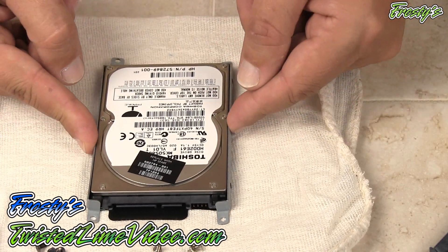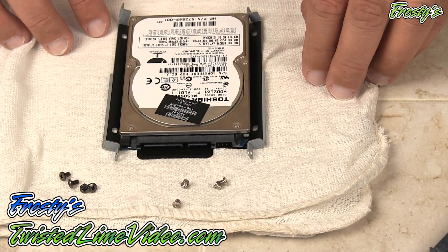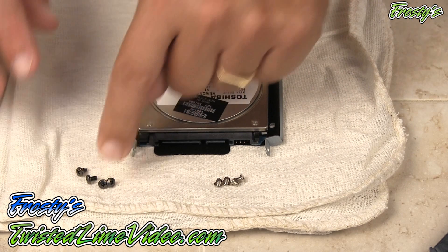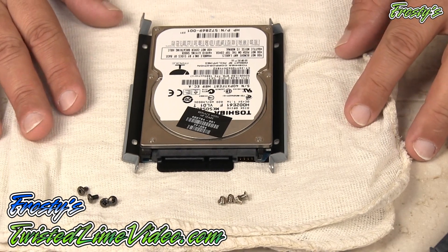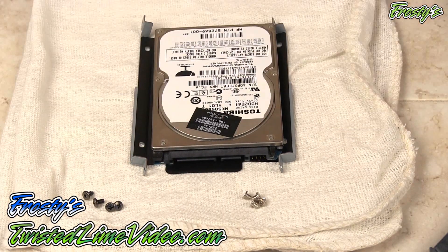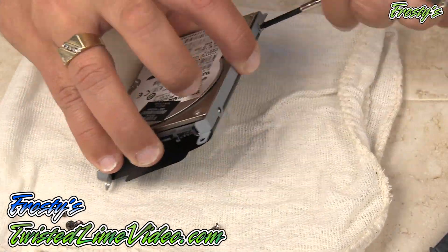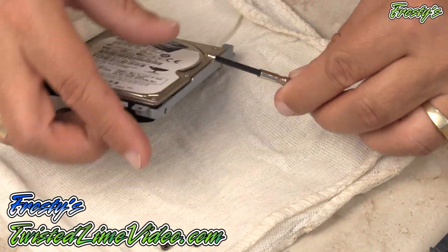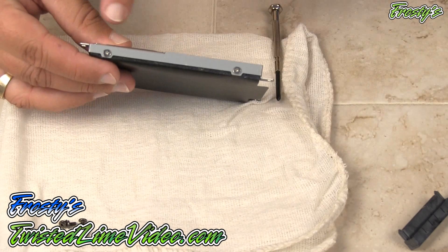That's the next step — now you know you're going the right way. You've got eight different screws: the screws for the hard drive and the black screws that attach the whole caddy onto your laptop. I'm going to attach the four screws to the four areas of the hard drive — one, two, three, four installed — and we are ready to install this in the laptop.